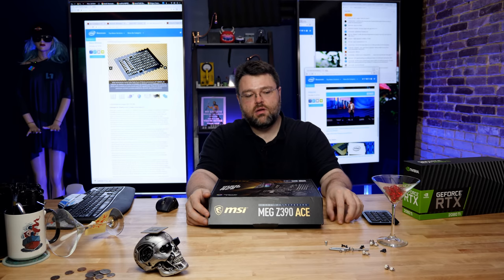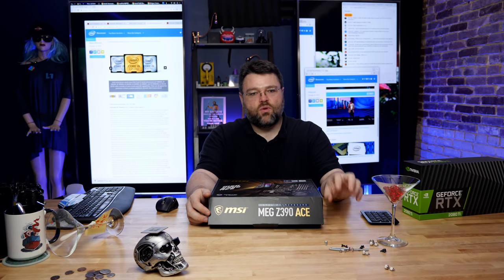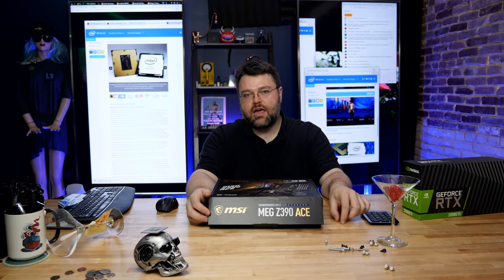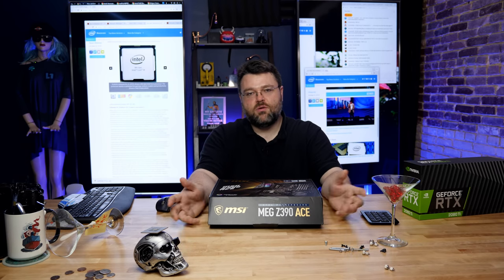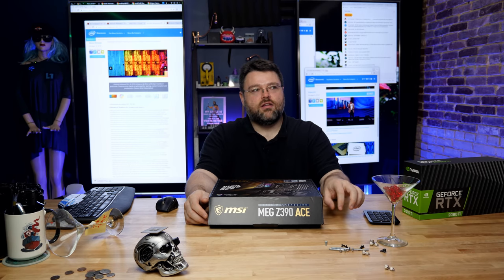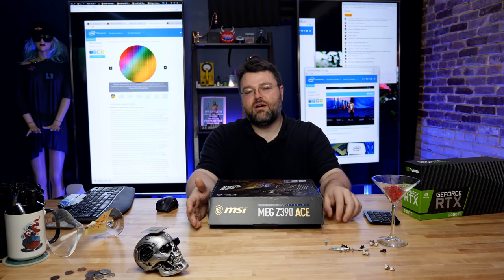And that is the socket 1151, it's kind of hard to keep all 8 of those cores fed, I'm guessing. And the reason that I say that is because certain types of workloads that were really good at working with hyper-threading on the 8700K, I noticed a slight dip in performance. Which suggested that those 12 threads on the 8700K, for certain types of workloads where hyper-threading works really well, meant that the rest of the system could not keep that CPU fed. There just wasn't enough memory bandwidth or PCI Express bandwidth or whatever it was for the particular workload to keep the CPU fed. So with 8 cores and 8 threads, I think that Intel is in a better position to keep the real cores fed as opposed to having real cores fighting with hyper-threaded cores that are probably not managed by the operating system correctly.